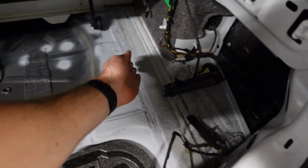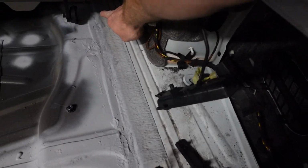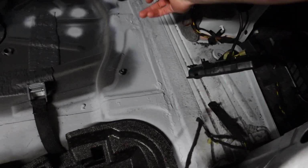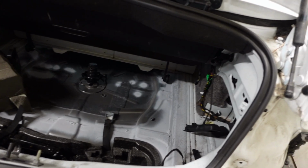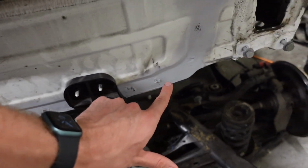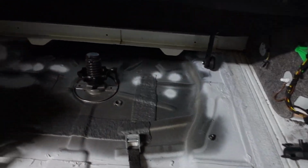So essentially what I did is I cut over here. If you take a real close look right here, the actual floor panel is not joined here. It's actually one piece. If you look back there, it's one piece, and it goes under these other sections. So I did not want to unweld and break up the entire rear end of the car and do more disassembly. So instead, I cut right along here on both sides, and from that car made sure to take ample measurements and cut only once. And so I did that, and also I separated this rear plate from that plate. I removed that first, installed that first, welded it in the original spot weld places. It's not the prettiest thing in the world, but I did make sure to epoxy things and things like that. So I installed that, and then I went ahead and put this main floor beam in place.